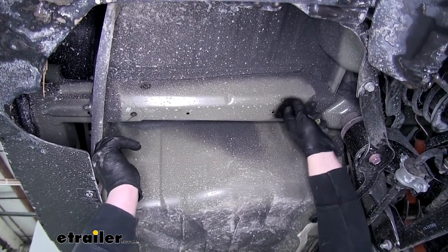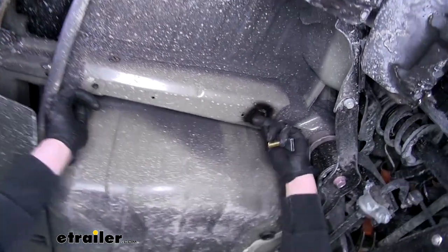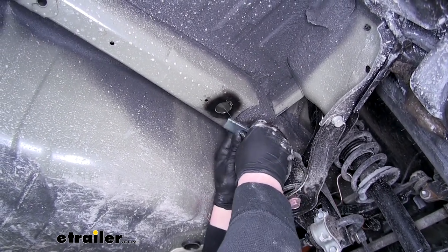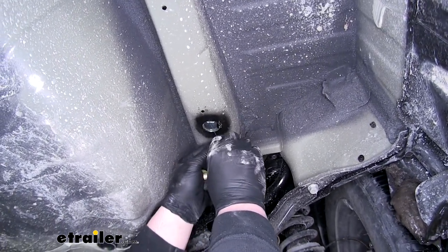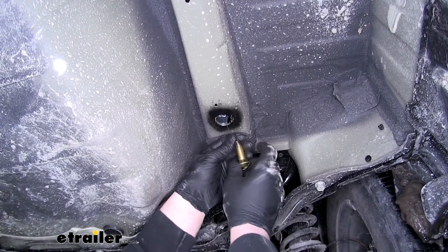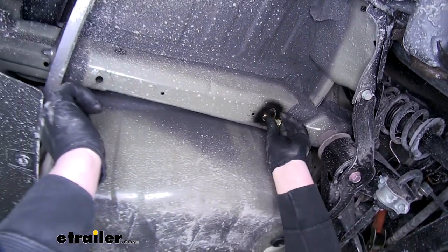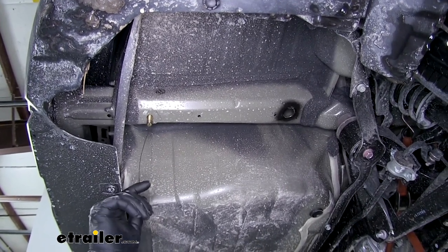You might have to get your finger in there to pull the coil end out. Then take the spacer block and loosely push it into the frame rail first. Take a carriage bolt, thread that end onto the fish wire, and pull it all the way through to get it to come out of the hole. Repeat that for the other side.